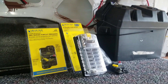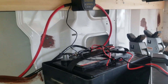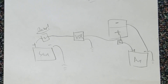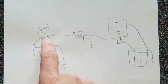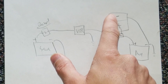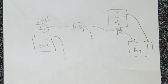What I'm going to do is tie in some breakers. I've got some 60 amp breakers and a fuse block so that I can run a couple of things without going directly off the terminals of these batteries. Because as I set this up just for temporary use, you can see I've got a mess of wires and fuses and bare wire attached to battery terminals, and that's not good practice. So I'm going to clean this all up. I find DC electrical systems to be pretty straightforward — there's simply a positive and a negative wire. The starting battery runs positive to a breaker, that breaker runs to the VSR, the VSR is grounded, and then the VSR runs to another breaker and that goes into my fuse block. The fuse block has positive and negative distribution — positive comes from the breaker and the aux battery, and the negative goes to the fuse panel and to ground.